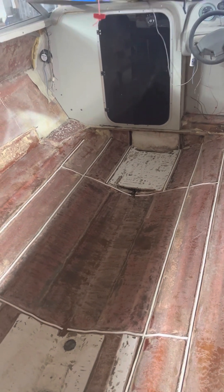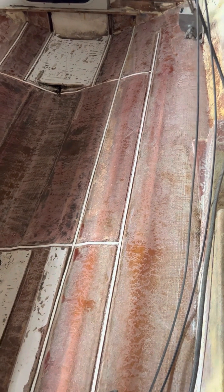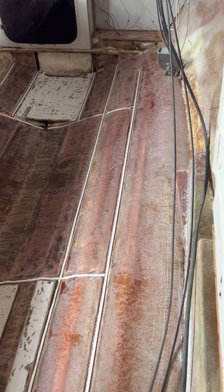What I like to do — if you look at the boat, you see where the hull comes up — I used to take a table saw and run that angle to give me the angle for the boat so when it sat down it was already sitting at the boat's angle. I don't do that anymore. Now I use a little hand orbital sander to create the edge, because it does two things: it lets me shape the edge to eliminate any unevenness or sharp spots on the bottom of the wood, and it lets me take off material as I go to make sure the stringer is seated across the floor correctly.